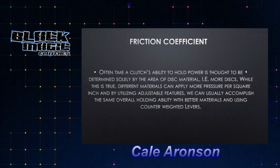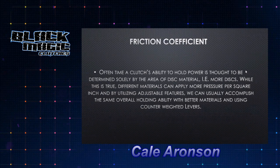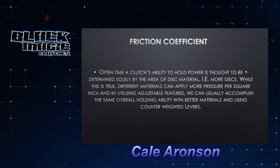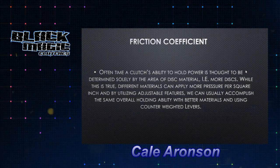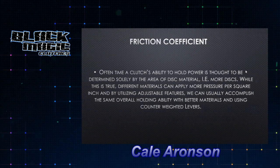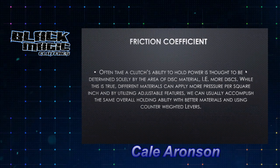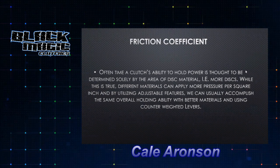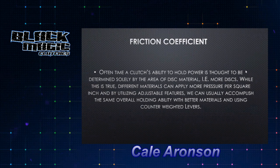10,500 to 11,000, anything in between, let's say 10 and 11,000, and be where you're like, okay, I literally only have 15 or 20 grams of counterweight under. You would a lot rather be 40, 50 grams of counterweight total, because your window is way bigger. If you're off by 6 grams running 60 grams, you're off 10%. You're off 6 grams running 18 grams total, you're off 30%. That's a little bit bigger of a change.